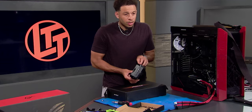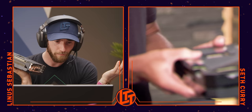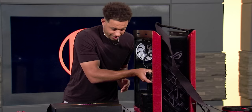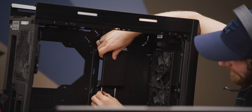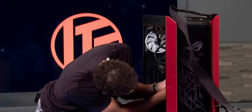Your top slot is the one that tends to have the fastest connectivity and your GPU needs that. This is pretty easy, but is the most expensive possible mistake you can make in this build. Just keep finagling it until it's in exactly the right spot. Once it's in, there's a little latch at the back of the slot that's going to close by itself. In your hand, that GPU doesn't even look that huge — it's heavy. Did that slide? Yep. So this slidey piece here — you can twist it to the side, slide it to where you want it, and it'll support the GPU from the bottom.